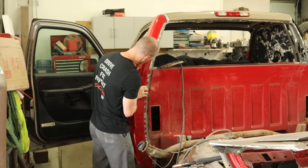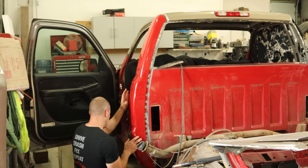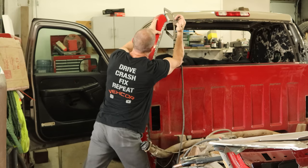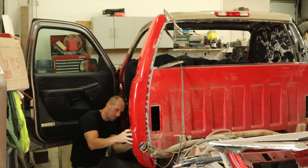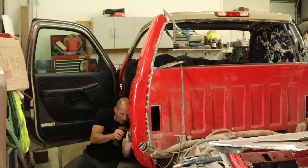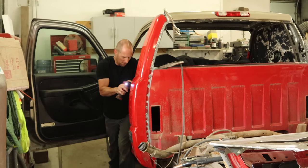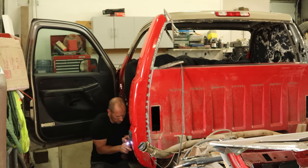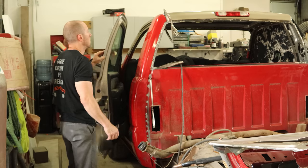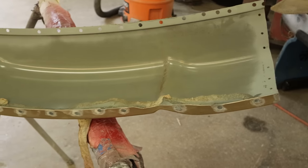So we slide it underneath the roof and slide it over the outside edges. We scribed some lines on there and we have our old seam sealer, so it pretty much should go right back where it belongs. We'll clamp up the top, and on the inside piece where we can't put a clamp, we're going to run some self-tapping sheet metal screws in there. That way we can close the door and make sure everything fits. This cab corner can move in and out a little bit to get our gaps right. Back side we can clamp — there's no door in the way. Close our door, see how our gaps look, make sure we're right in and out. Now we're ready to do our passenger side.